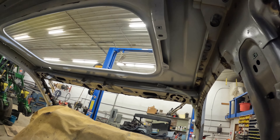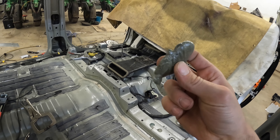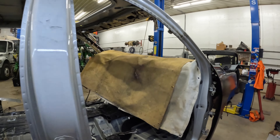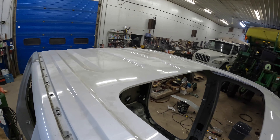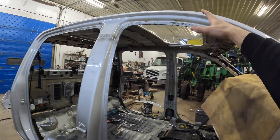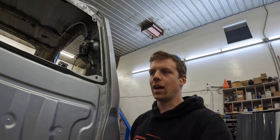Alright, so the roof skin is glued in place and I just put a few clamps on it for tonight. Tomorrow I'm going to come back and weld up all the small seam welds on here. This foam stuff hardened up so fast — pretty cool stuff. It's looking pretty good and should be solid in place and ready to weld all those small walls up tomorrow, then I can get this thing all prepped for paint. Just got to do a little bit on this uni side here — it's pretty close but just a little bit of work.